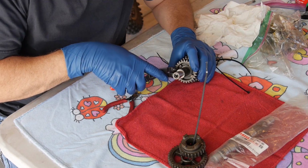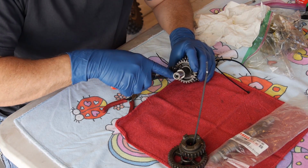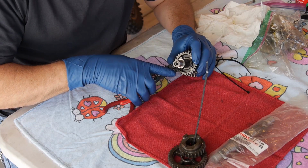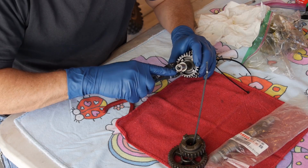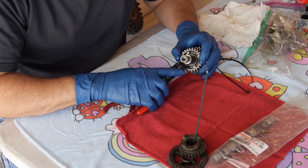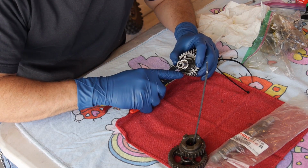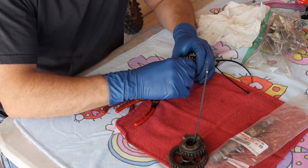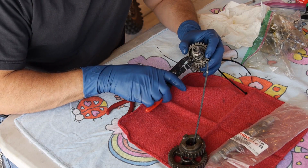Cool thing is, if you have the manual and you get screwed up, you can take your time, look through the manual, and make sure you've got all the parts going back in the proper place. If you screw something up on this and you put it all back together, it's guaranteed to give you shifting problems. If you're off 20 thousandths of an inch on something, this deal will not shift.